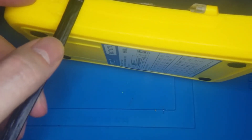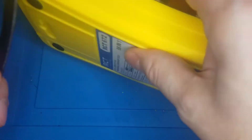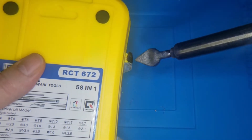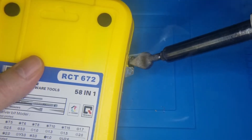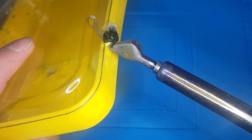I'm basically going to cover the area like that, and then we're going to need to cut it. I hope I didn't cut too much — that should be fine. Now we just need to spread it out. With the FiberFlex welding rod, we're not trying to mix it with the underlying material — that's not how this thing works. It's really just an adhesive on top.